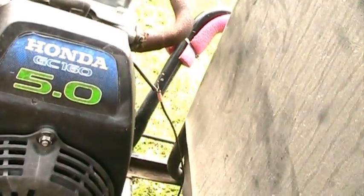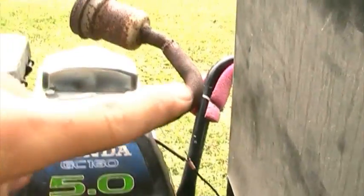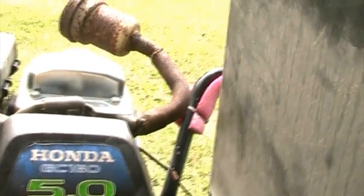This thing's top speed running like this is 18 miles an hour. It used to run 40 with that Tecumseh motor, but I wanted a Honda engine on here. You also have to do a custom exhaust — I'm not going to give away my blueprints but you can get the picture. A Briggs and Stratton muffler will fit a Honda engine. That little insert I have welded in there — that piece where the bolts go through — is the original Honda engine fitting.